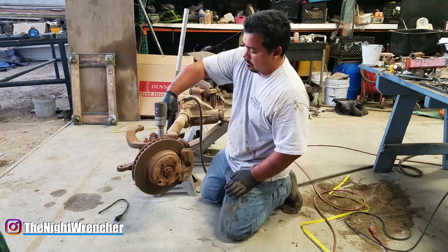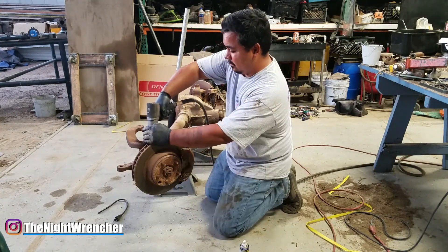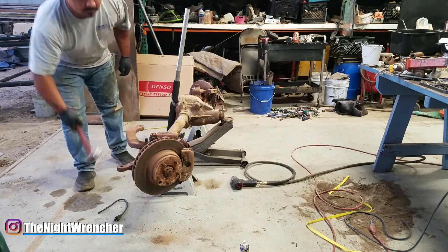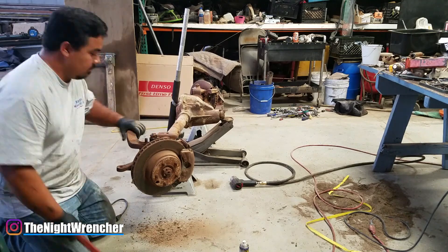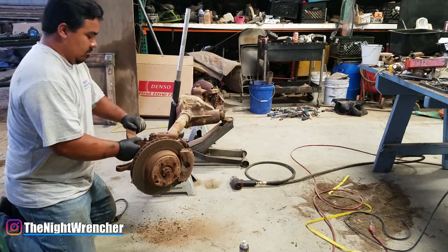Because of the way the bearing is set up, it doesn't offer a lot of support — especially when you upgrade to larger tires like 35s, 37s, or 40s. The carrier in the middle ends up being very weak. The rest of the axle is pretty stout; it's all one piece all the way across, and then you've got your center section — the obviously famous Dana 44.